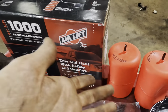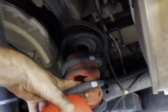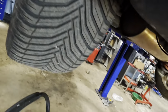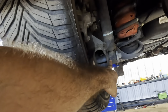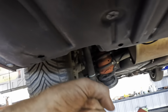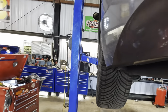These people didn't pay me to install these components or make this video. I'm simply replacing the torn out, worn, dry rotted bags with a set of replacements. What we need to do here is pull the wheels off, support the axle with jack stands on either side, then remove the shock absorbers from the bracket. That's going to allow me to lower the axle down, taking pressure off the springs. Then we can pry bar the springs out, pull the bags out, put the new bags back in the springs, and reverse the procedure for installation.